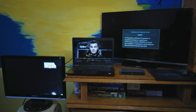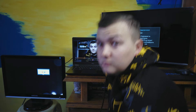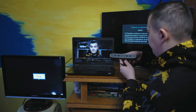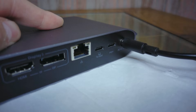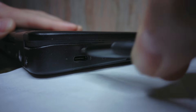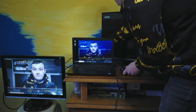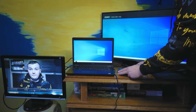For this video I want to demonstrate how to extend display images across three monitors. It's worth mentioning that we have the ability to connect 4K displays, but unfortunately I only have Full HD. To do this, turn on the docking station and connect it to the laptop using the included USB-C cable. Then connect the monitors to the docking station using HDMI or DisplayPort cables — in my case I will use both.